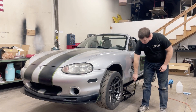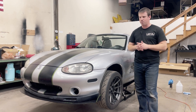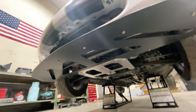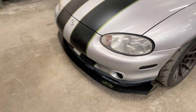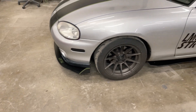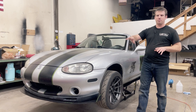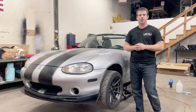Secondary function: we are making them real and they're not plastic. They're all aluminum, mounted securely, and not just mounted to the bumpers. If you hit a squirrel, an autocross cone, or kick your foot into it walking around the car, you're not going to damage the body in any way. I've done plastic splitters before that just bolt to the bumper and eventually wind up ripping the bumper off when you hit an autocross cone.